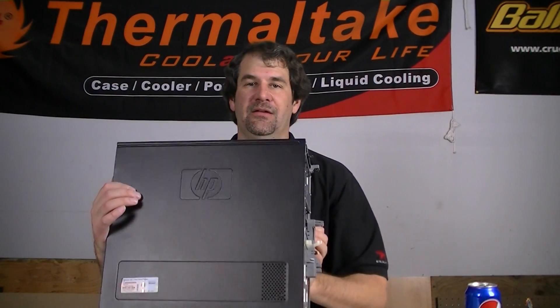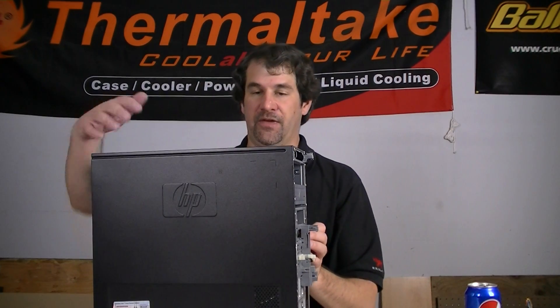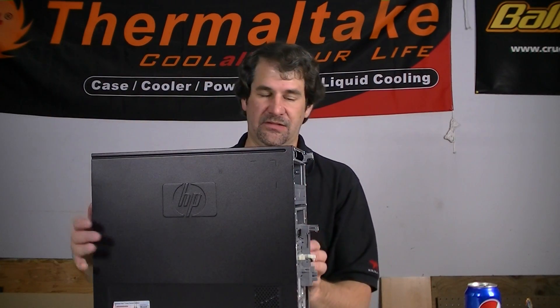Now that we've gotten all the hardware out of this HP Pavilion chassis, we can start looking at what we found. First of all, and this isn't uncommon to OEM cases, we have different style plugs to activate the motherboard — power and reset, a couple of LEDs — and these will all have to be adapted to run on our EVGA X99 motherboard. The case itself is very traditional. If you remove the top panel it's very square, but it's also a bit of a unibody in that the back is riveted in place, so if we need to do any modifications we'll have to remove the top and side at the same time.